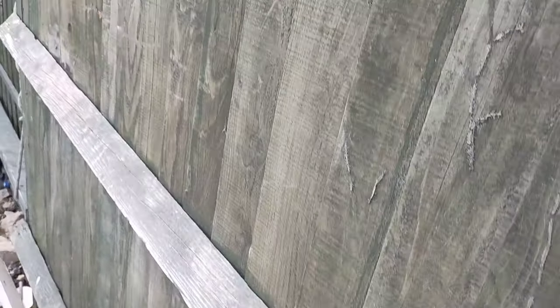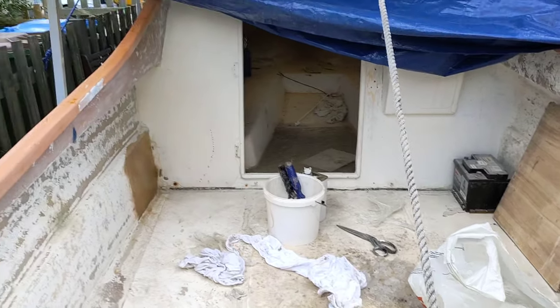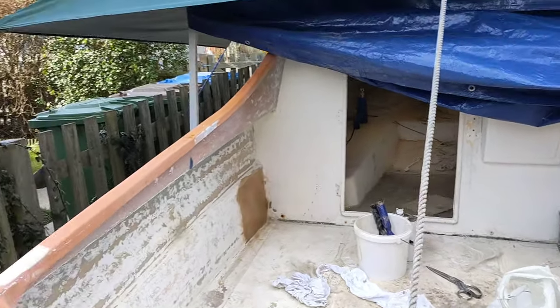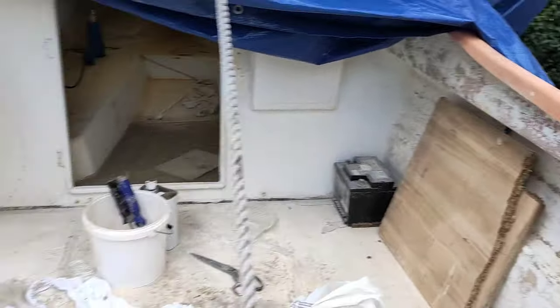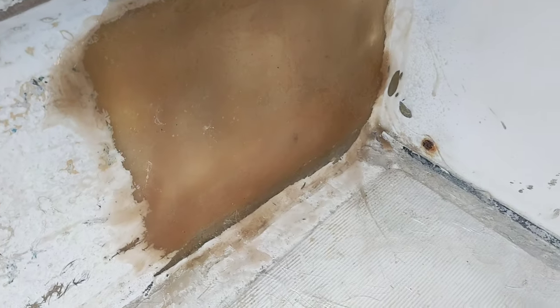while I was waiting, the resin still hadn't gone off, so I decided to tackle these ones, which was a bit of a scramble, because I had to cut three staggered pieces. You start off with a smaller square, then a bit bigger, and then to the actual size of the repair. So it was a bit of a struggle, but that's the gist of it.